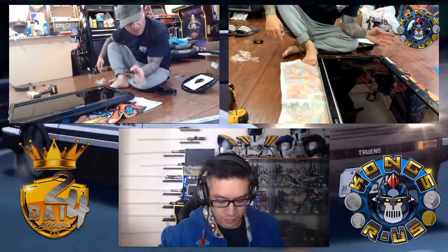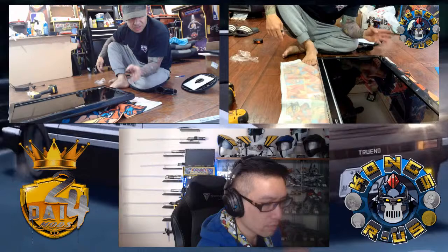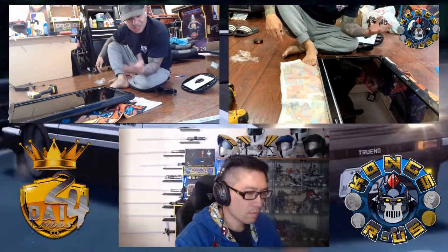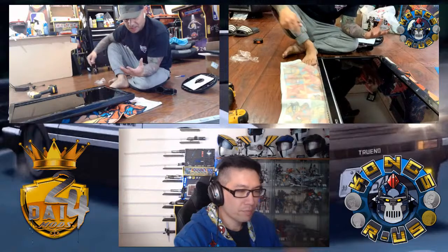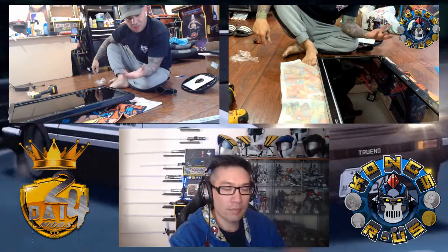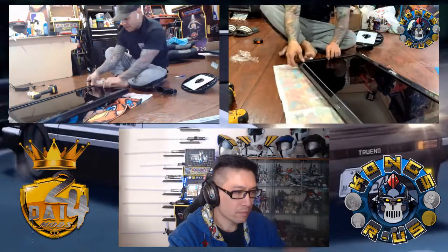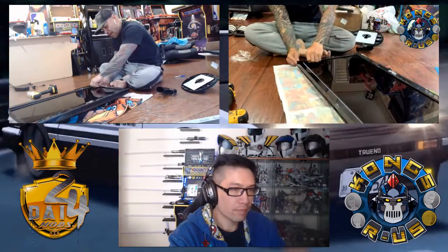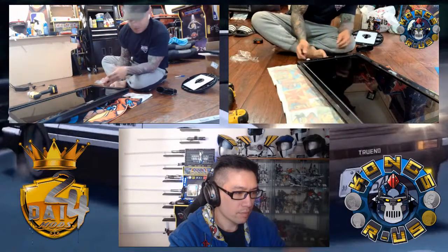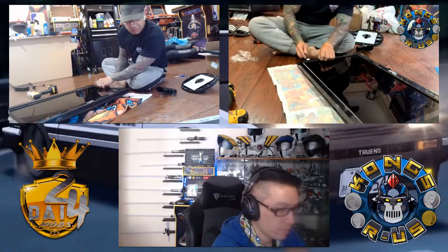For one, Arcade1Up, okay? The cabinet is very fragile. You want to decase it to line it up, so that it's not too heavy to pull down the cabinet. The wood is pressed wood, it's cheap wood. So the lighter the weight, the better it is for your monitor to mount and the less hassle. That way it won't fall apart. And to customize, to fit a 20-inch monitor into an Arcade1Up stock monitor frame.